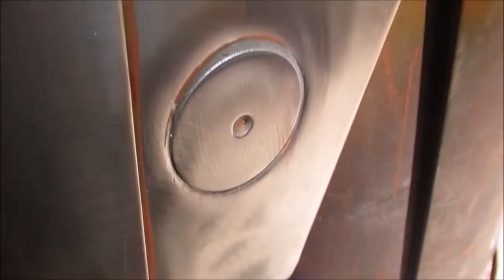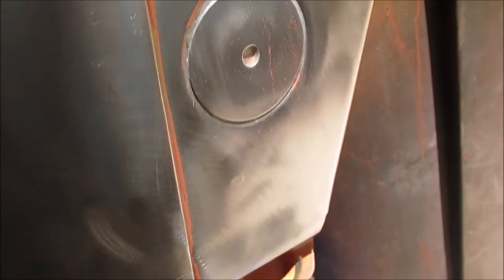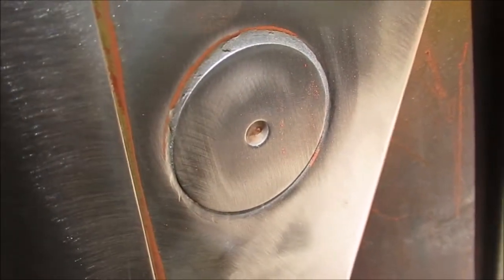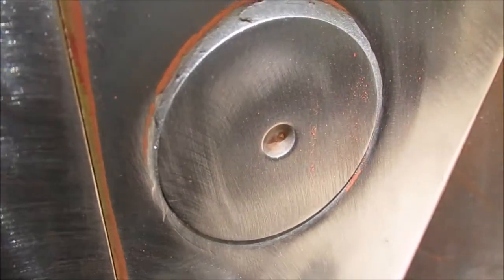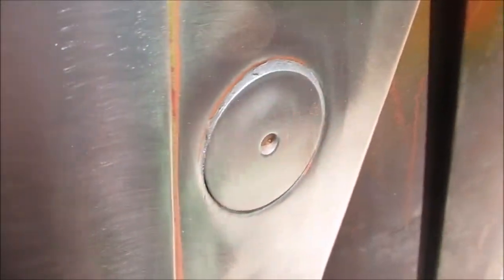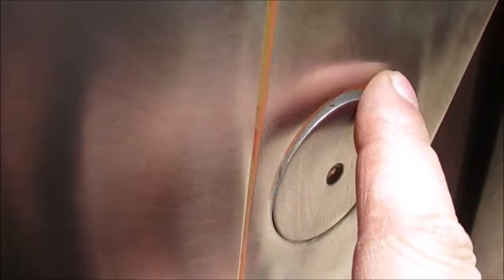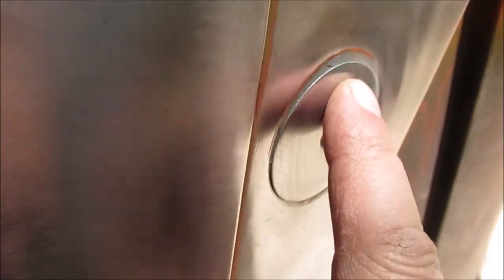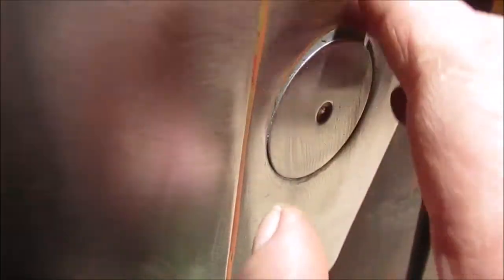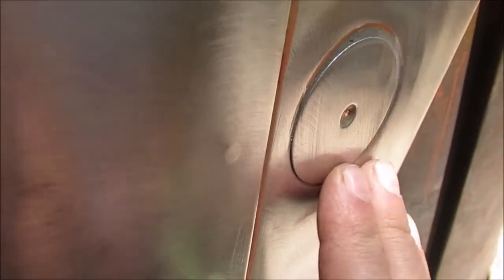And we had pictures on it. If you see my package of Road King, I gave you a sneak peek of how I plugged that hole, and that's just clear epoxy behind there, and that's a penny. There's a penny covering that hole from the other side, and it's indented. Bondo will go right over top of this. It sticks up a little here, so we may take the flapper disc and do a little bit of rough grinding.